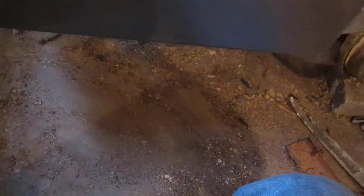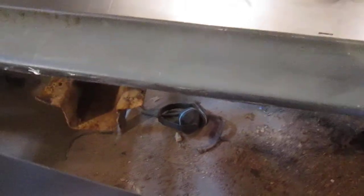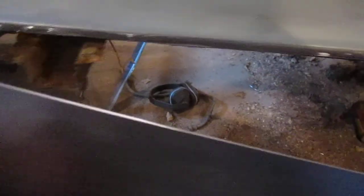I'm going to obviously have to cut a little bit — I probably can't see it in the picture, but I put a little mark there. See a little shiny mark there? One here, and then there's another one back there. So this piece here is going to have to get cut down with a plasma cutter. I'm going to measure how much I have here to figure out how much I've got to cut off so I can butt weld it right up against it, tack it all along, grind it, and she'll look pretty good as new. You won't need much bondo to get it to look good.